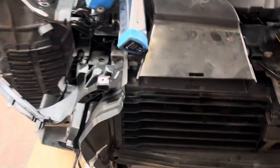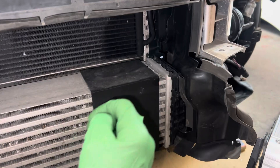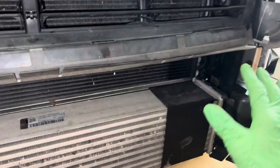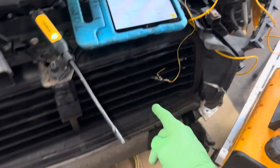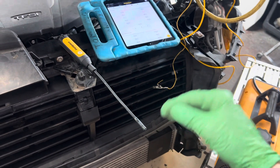I'm also looking for a known leak on this one. The old condenser has a leak right here, and even though this is collision work it has nothing to do with the collision. I was curious what size it must be — a real slow leak. So I put UV dye in, broke out the UV light, and looked for an obvious sign. It passes that test even though we know there's a leak and the UV dye is circulating. There's no obvious leak. Then I broke out the leak detectors. Even if I spot a very small leak, the insurance company won't replace that condenser as part of the accident. But I always like to test my equipment and methods to see what size of leaks are deemed acceptable or not acceptable.